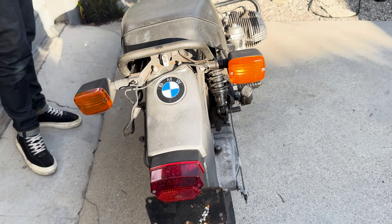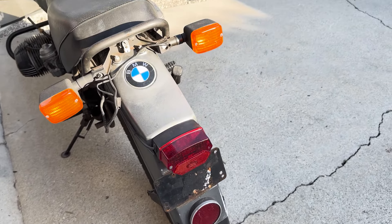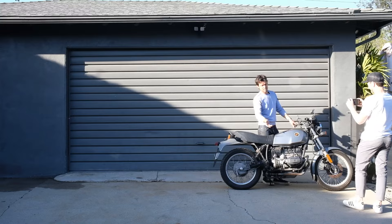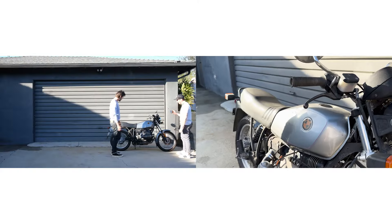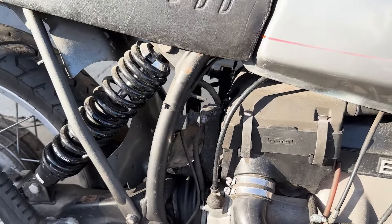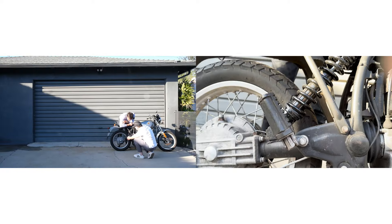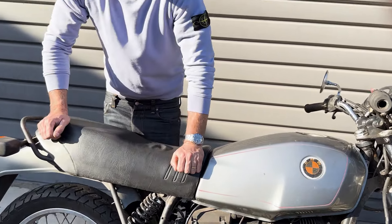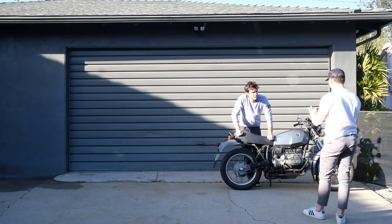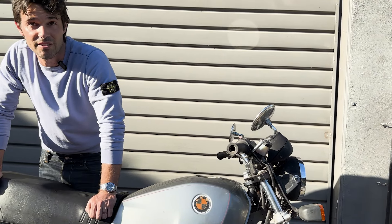No, we won't try to crank it — just take it apart, take the crank out of the block, and start again. What we have here are beautiful ingredients. For all the ST Mafia out there, someone's going to want parts from this: a crusty gas tank, fenders, forks, front wheels. We've got the single-sided swing arm with the three-lug bolt-on hub. We typically extend these on our builds — 50mm longer — and extend the drive shaft. The STs came with a higher ratio rear end, nice for freeway cruising.